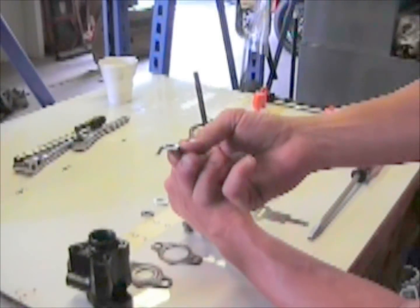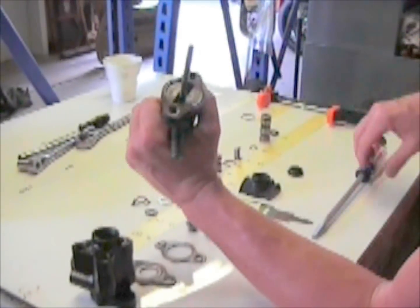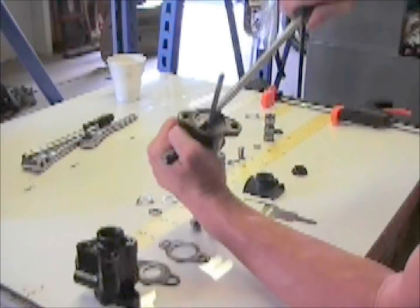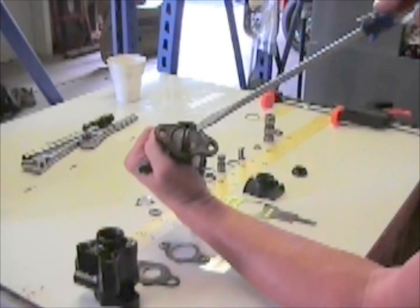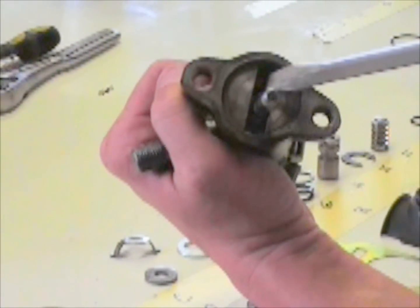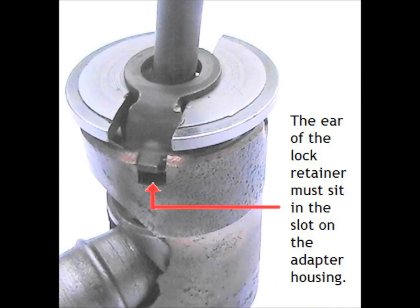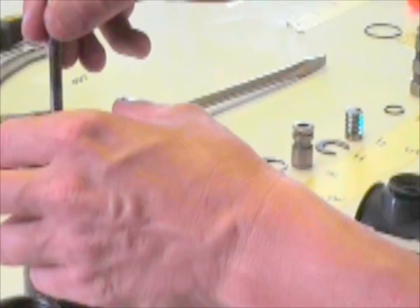And it installs like this. The 2 ears will lock in. So you'll have to loosen it a little bit after you tighten it. You'll loosen it to line the notches up in the valve. Right there. Hold on, let me zoom in on that. Got a notch right there, and on this side. So you just snug it up and then back it up till you hit the notches, kind of like doing a cotter pin. Yeah, exactly. And you drop that piece in.